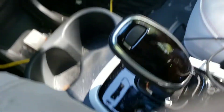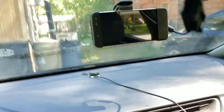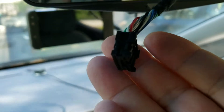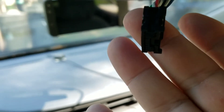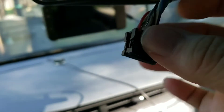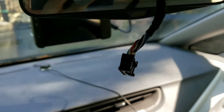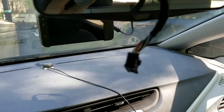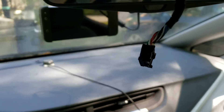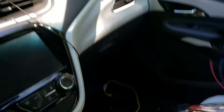I got it pulled and the shifter did not light up. If at this point, while this is hanging loose, I were to touch any button in this car — like the lock, or open the door — it would bring the CAN bus online, and the CAN bus now has half the car disconnected by not having this plugged in. So that's really important for you to know. If you're ever messing with this, you have to wait three to five minutes for your car to be shut down. You can't touch the door handles, the locks, anything — until this is either plugged back into the camera or into the harness.